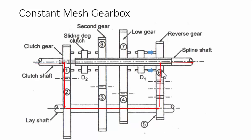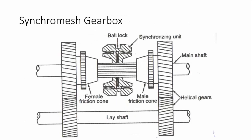The main advantage of constant mesh over sliding mesh gearbox is that gear tooth damage is avoided. In a sliding mesh gearbox, gear teeth are damaged because gears slide over one another. In the constant mesh gearbox, all gear teeth remain meshed and there is no sliding, so gear teeth damage does not occur. Instead, dog clutches are used, and since the dog clutch teeth may wear, they can be easily replaced. In the next video we will cover the synchromesh gearbox. Hope you have understood both the sliding mesh and constant mesh gearbox.